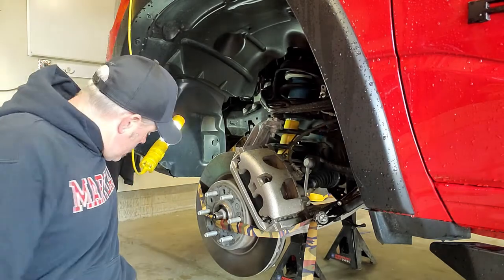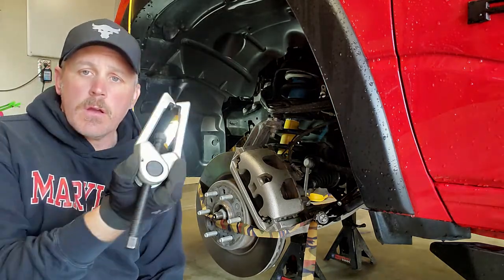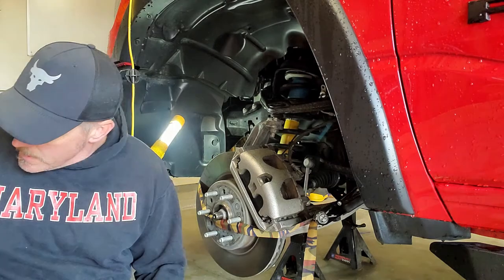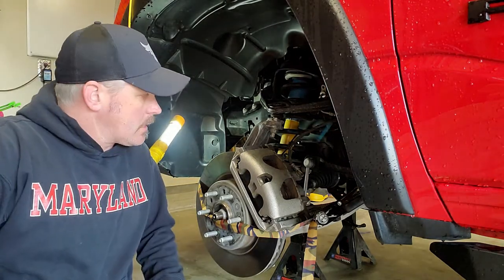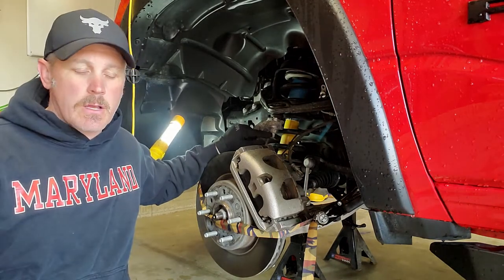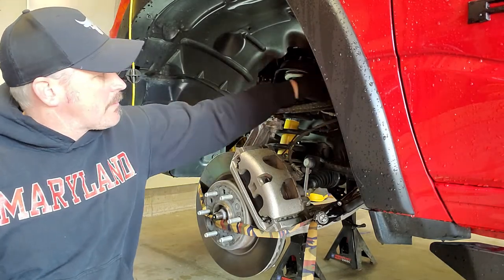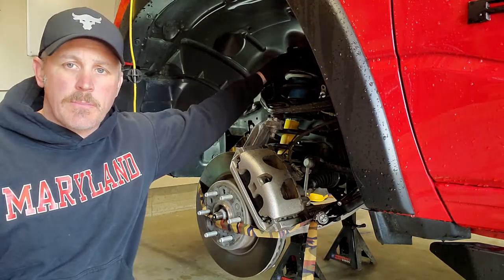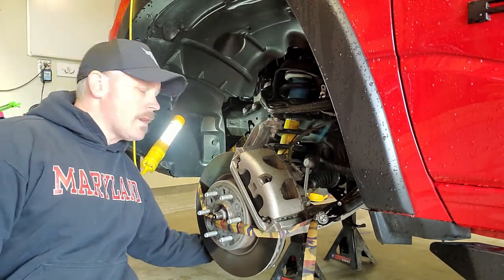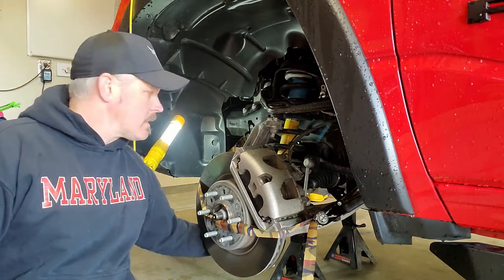So I had to get into the tactical reserve there, wherever the hell it went, and go into some specialty tools to pop that ball joint loose because it was in there pretty good. And I was worried I was actually going to damage the knuckle. So needless to say, we leave the nut on there, and I was able to pop it loose. I'll give you all the nut sizes in the description. It's just gonna be easier. But I've already loosened up our upper control arm bolts as well as our top hat bolts just to loosen them up so I don't have to struggle with it. I've also loosened up the lower fork bolt that goes down into the lower control arm for the strut assembly.